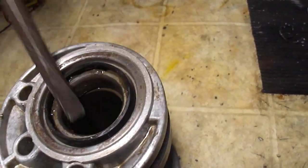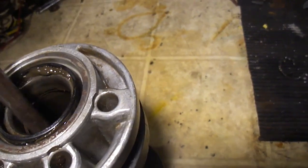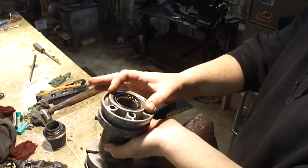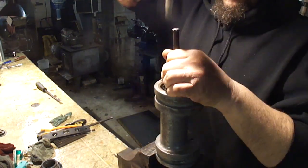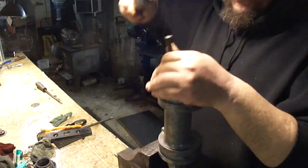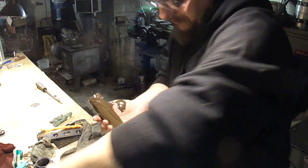You're just going to push that thing over to the side, come in through the other way, catch the edge of that bearing and tap it. Once you feel it move, squish this thing over the other way and tap the other side of the bearing race, and keep going back and forth until it comes out. It'll drive the seal out along with it. The bearing is going to want to come out this way, so set this on something that will allow that — I'm setting it on my vise with the jaws open far enough to clear. There's a seal — it just fell out.